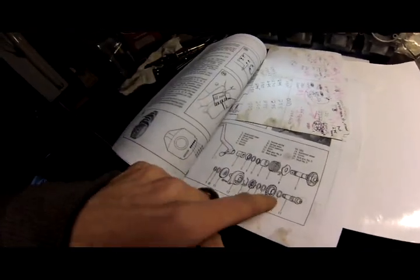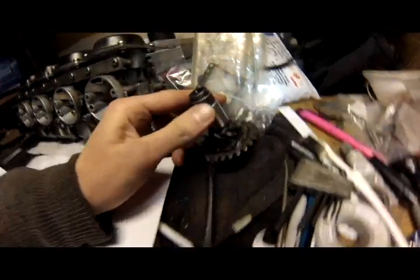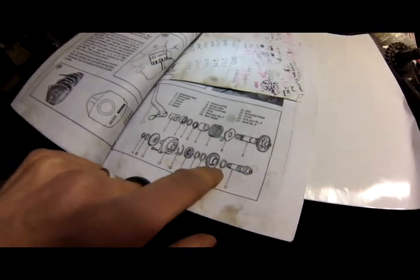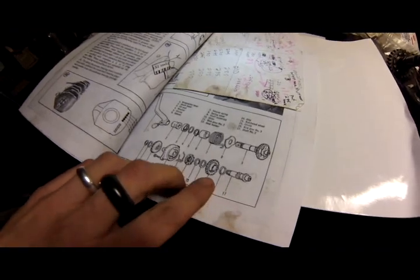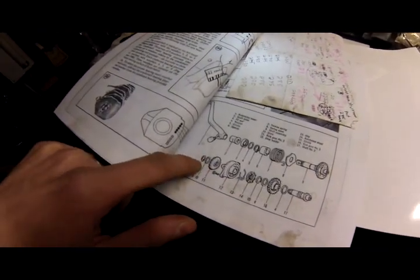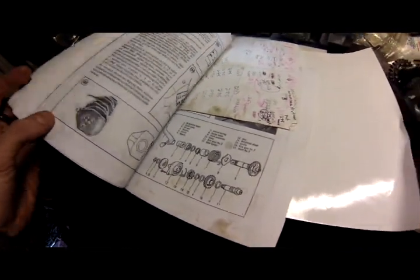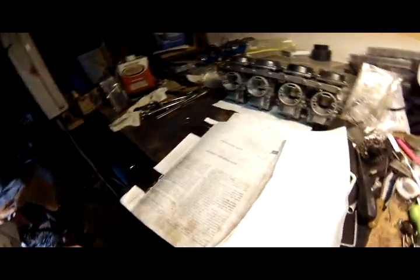Because that gear is already on there, that's in it. As you see with this one, it has a circlip in it. That's how that ratcheted gear is already in place on my bike. I'd have to split apart the case, I guess, to get that back out. But I'm adding this, and I'm just putting that on it, and I made that washer, and I have a circlip that should work for that because it held on the other idle gear the last time I put it on. So I'm going to clean up some bolts and start putting it together.